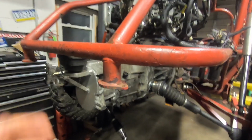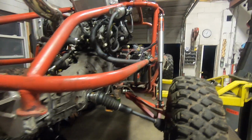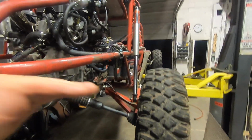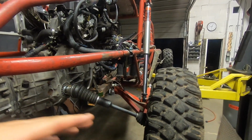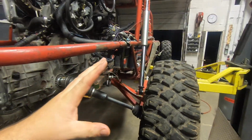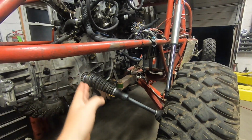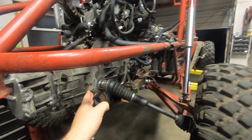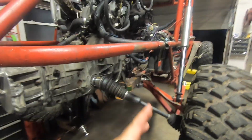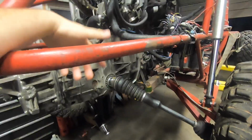Now, looking back, we've got a transmission that's rubber mounted. We've got an engine that's rubber mounted. We've got frame and trailing arms that flex. Perhaps what may have happened was this axle was pretty well lined up straight, and me sliding through the yard, kicking the clutch, doing my thing, this CV came together and bottomed out. And when this part bottoms out, it's going to transmit all of that force going this way into the center star, which in turn is going to try to move the balls where it wants to go. The cage is what retains that, and the cage is blown open sideways. So it's kind of consistent with what could have happened there. So that's just a theory at this point.